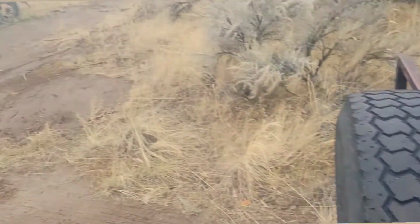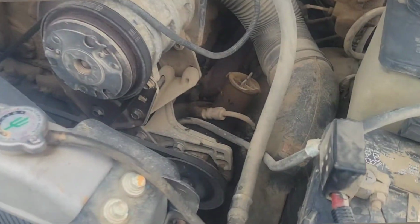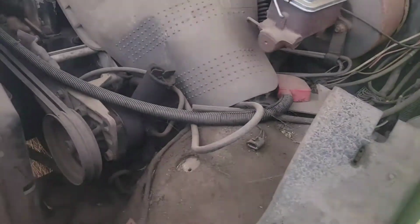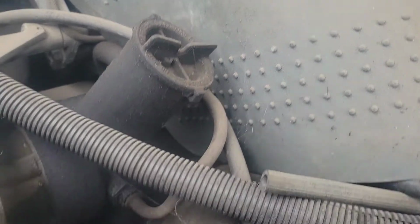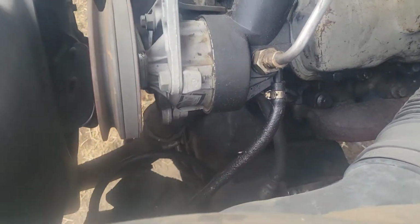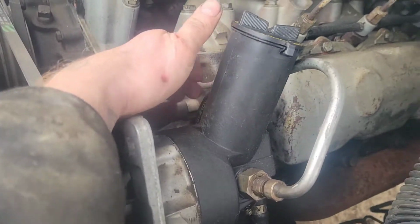So I got that apart, and now we're going to have to pop this little O-ring into that groove. Let me check this truck and the other truck just to see the routing of the line, so that I don't put it on the same way and cause myself the same problem, if maybe there's a better way to route it to keep it from damaging itself. So the yellow banana, its pressure line goes back around that way instead of up over that way like Blue Nose had it. Wow, this one mounts way up high, but again, it is mounted with the line coming up and around that way instead of like Blue Nose had it around here where it presses on there.